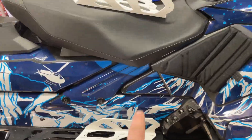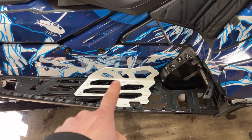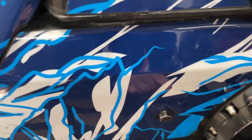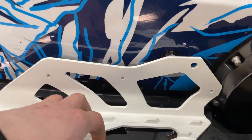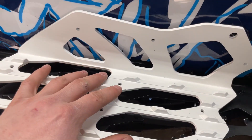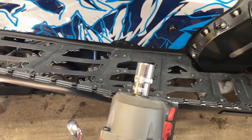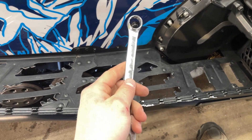I'm going to show you this side — not the broken side — this could be more work, but I'll probably do a time lapse on that side. First thing we're going to do is remove the suspension bolt, which we'll use to line up our template. I'll tape off on top of all these holes, drill it on the sled, then put the rivets in. What you'll need is a 16mm on an impact and a 17mm wrench for the nut on the back side.